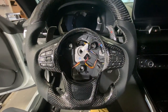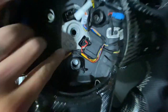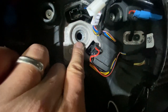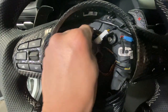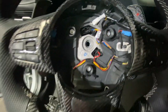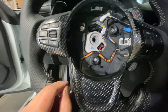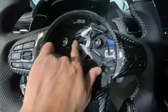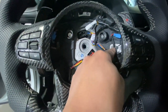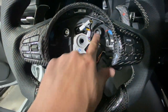Back in the car — a couple things to point out. There's a little marking — if you look closely there's a stripe. Make sure you line up the stripe so they match, which centers the wheel. Plug in the connectors — the top one first, hear a click. The red one goes in the middle — click. All connections are made to the ribbon cable except for the airbag, which we'll do last. Make sure wiring is tucked in, then snap the airbag back into those three clips.